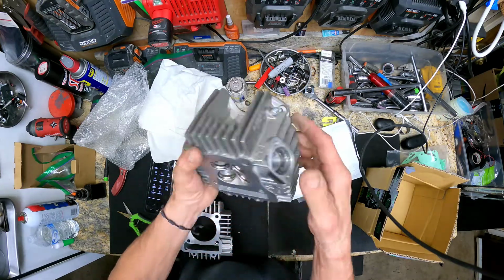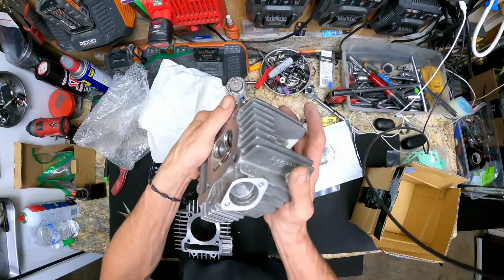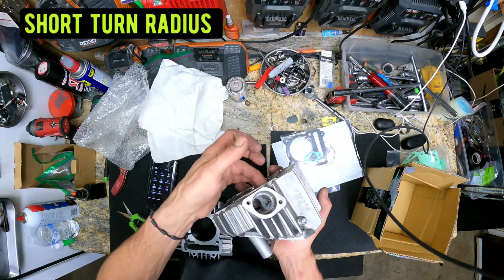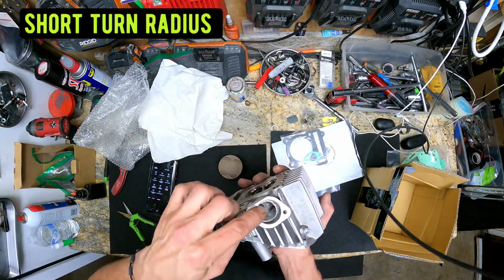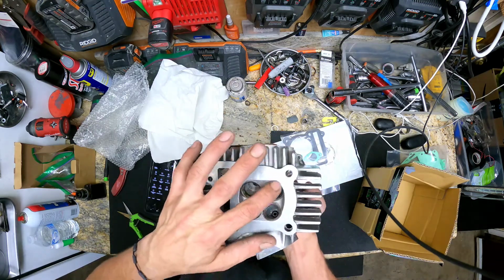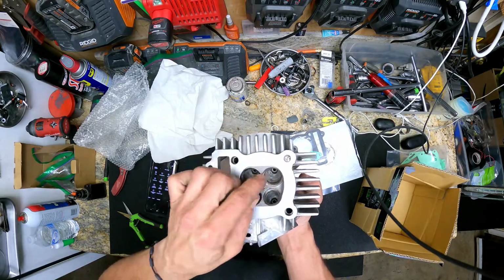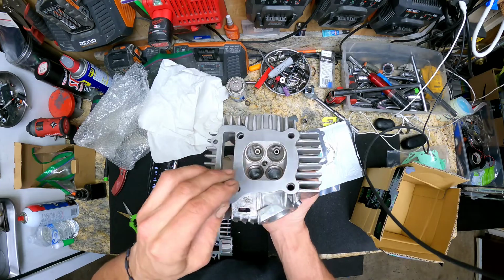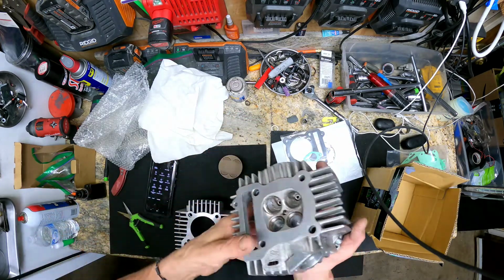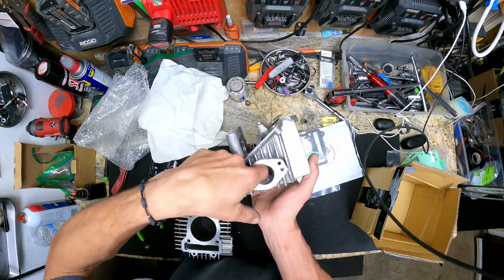That's the intake, right? The exhaust, I basically got rid of this super hard turn right here. If you look right up in there, super hard turn. Kind of getting rid of it, ovaled it out a little bit. Basically, all that really matters is the seat transition in there. You want to make sure that's a smooth transition from the seat into the bowl. Then that hump in there, you just want to knock that upper part out. You want it to be as straight into the port as possible. So it's straight and straight. You know what I mean?